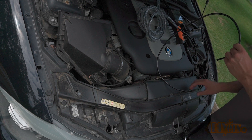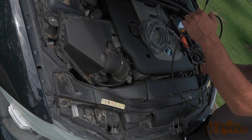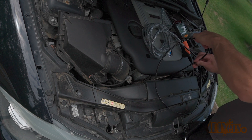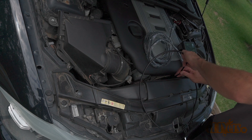Another example is using the camera on a BMW. This particular engine is the M57 diesel, which is known to have harmonic balancer failures. Early signs of a worn harmonic balancer is cracking on the exposed rubber damper, which is almost impossible to view directly or even with a mechanic's mirror. However, putting the probe down there we can quite easily see the cracking that is beginning to start.